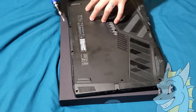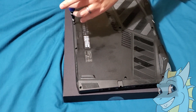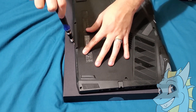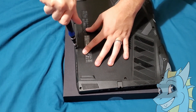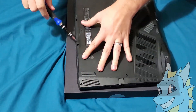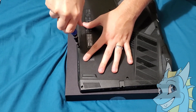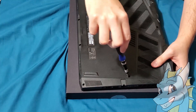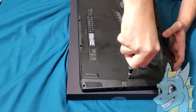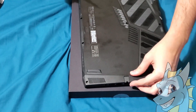You also have to be a little careful when you pick the RAM memory for this model — I'm going to leave a link in the description with all the specifications it needs to have. If you have the 8GB model in this laptop or any laptop, I really would suggest you upgrade it to 16GB so you can make use of dual channel memory. If not, your RAM is working in single channel and the computer is not making full use of all the performance of the RAM.